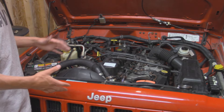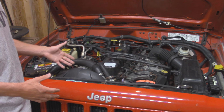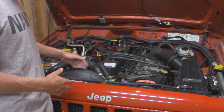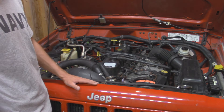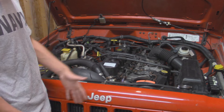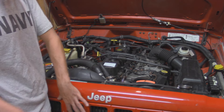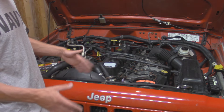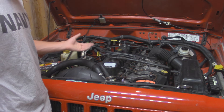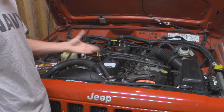Now that we went over all the components, if everything is up to date and working properly, you should have an efficient cooling system. For me, I've replaced most of these parts — water pump, thermostat, radiator, fan shroud, everything — and this Jeep still has an overheating issue, especially on a warm day with the AC running. With the AC on, warmer air goes through the radiator because the condenser is in front of it. To compensate, the electric fan should kick on so the engine doesn't overheat while still keeping cool AC.